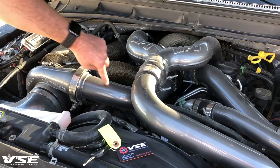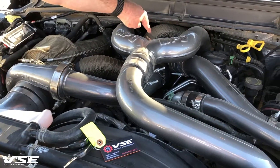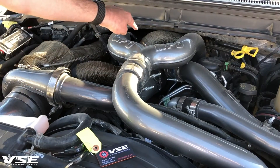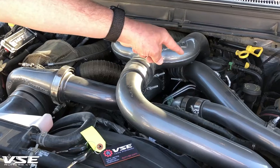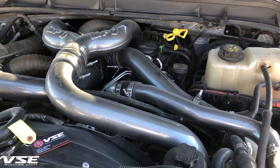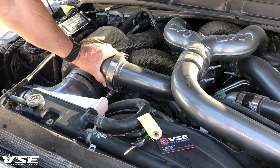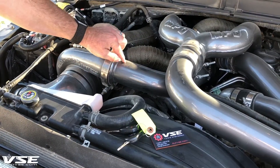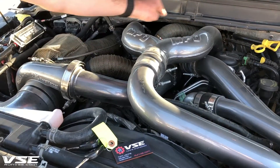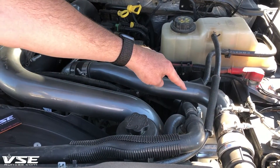This charge pipe can reach over 30 pounds of pressure, and this turbo now only has to raise pressure from 30 pounds to a maximum of about 40 to 50 PSI of charge pressure. Fresh air comes in here, this turbocharger is spooled by the exhaust from the 2015 turbo, this raises boost pressure up, and then this turbocharger inhales the pressure from this turbo and sends it through the water intercooler here.